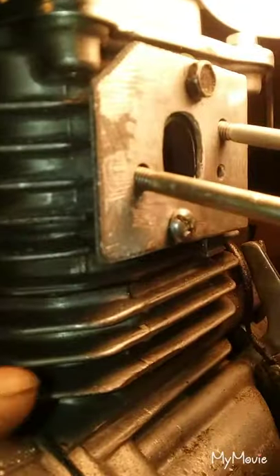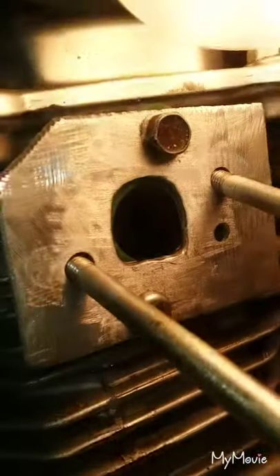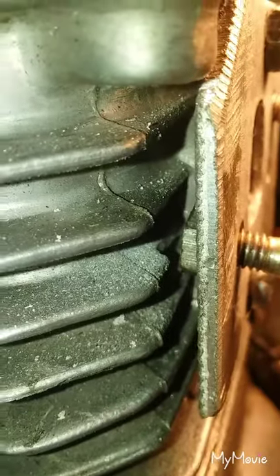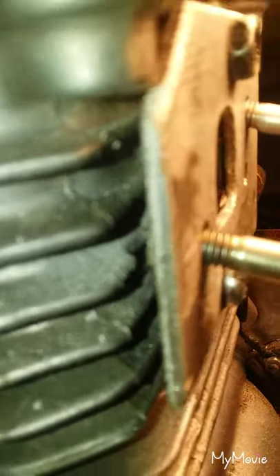The plate of aluminum that I made — cut my matching bolts there. And these are the bolts that came with the carburetor in the back here. You can see where I cut into the fin right there to allow room for the bolt — do that on both sides.